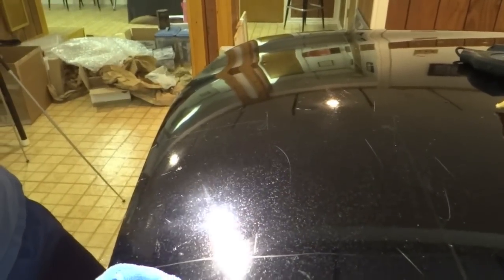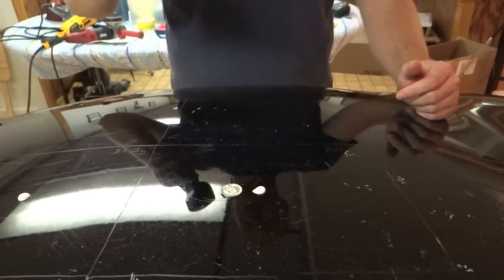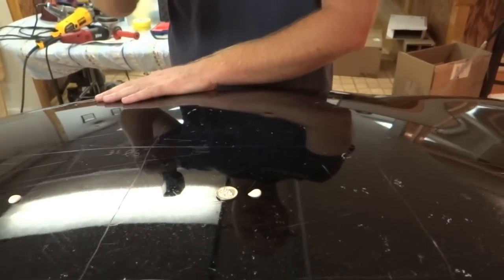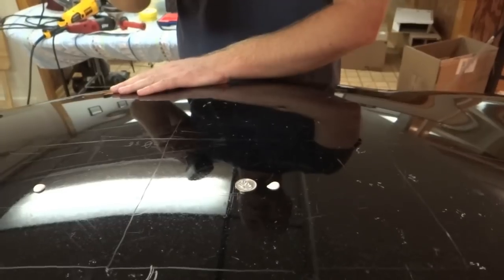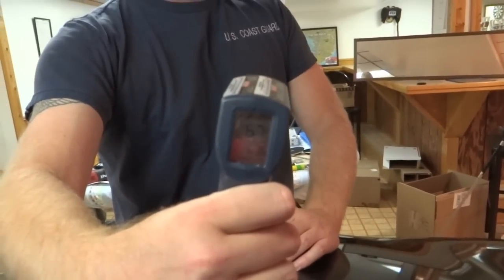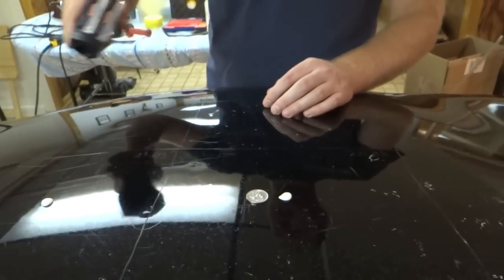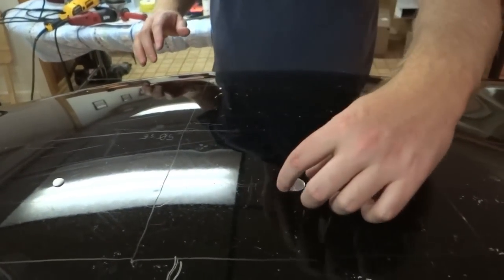All right, I guess we're going to hit 40 seconds. I just want to show the temperature of the paint, because we did check the temperature on the 30-second panel, and it did rise about 20 degrees. It was only 85, but we started around 60. And let me go ahead and temp this one out. You can see we're at 67. So we'll see exactly how much warmer it gets doing this technique.